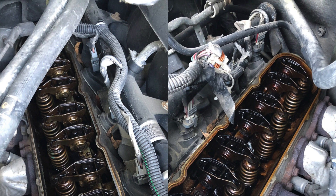Here's some more evidence — a couple photos I cropped together of the left and right cylinder head showing the rockers in there. You can see the picture on the right has got the orangey burnt tinge to it. Obviously the side that cracked — you can even see down in the bottom there by the valve springs a little glob of sludge. And yeah, it just reconfirms it all.